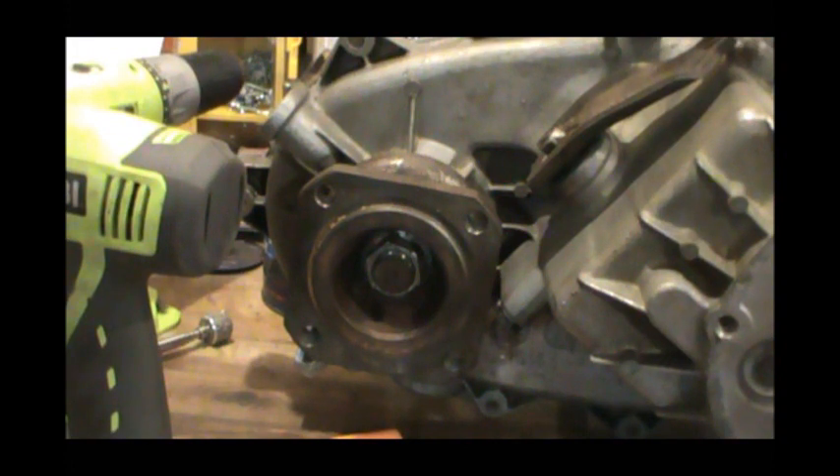Let's see if it tells you anything — align front output shaft thrust bearing assembly and front case, correct installation sequence: thick race, thrust bearing, thin race, install front output shaft. It doesn't say anything about checking end play. There's nothing in here whatsoever about checking end play. It just says thick, thin, and in between thrust bearing.